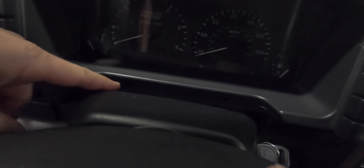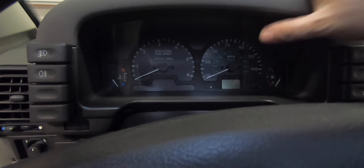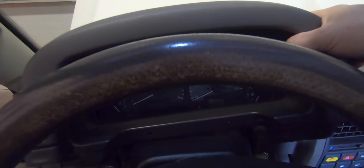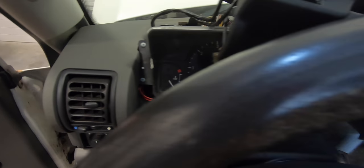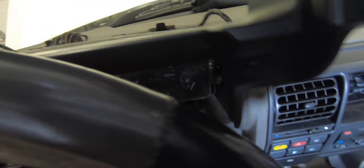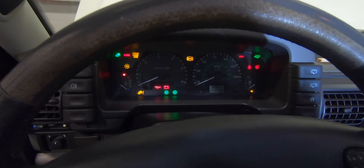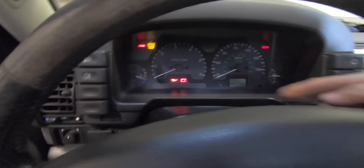Since it runs now, I'm going to replace the instrument panel too, just for the heck of it. To do that, push the button on the side, pull your steering wheel down, and you have access to the two little screw holes right there. I've got the two screws down here loose. There are some clips at the top and some wiring attached to it. You can see there are two screws on each side that hold the instrument panel on, and a couple of wire harnesses up at the top. I'll get this out and install the new one. I haven't put the last screws in yet — I wanted to test this and make sure it works before I put these last two screws in.